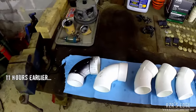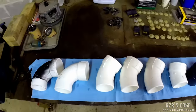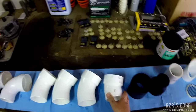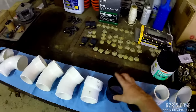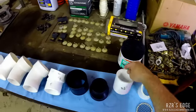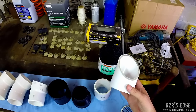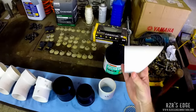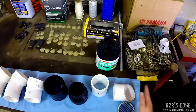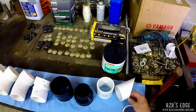Let me go over the parts list. The first part is the engine air intake. You're going to have two three-inch street 90s, three three-inch street 45s, then a three-inch street 22, and then a three-inch flex coupler, and then a two-inch to three-inch flex coupler, a piece of pipe that's three and a half inches long, and here's the tip I made for the end of the risers. This is three-inch pipe cut at a 45-degree angle — the short end is two inches, so you measure over two inches and cut at a 45-degree angle with that being the inside of the angle.